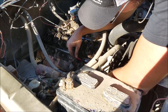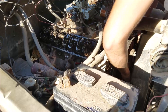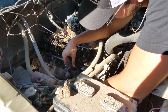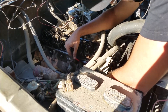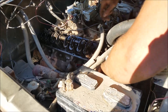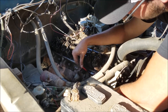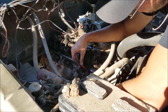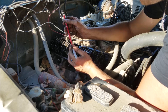Our measurements show we're still going down. Turn it over a little bit more — make sure to keep your permanent marker aligned. Continuing to turn it over a little bit at a time to see if we've reached our dwell point. It didn't move on that last turn. Our mark is okay — it started to get shorter now, so we've definitely reached the bottom. One more verification: the piston is indeed coming back up. You can see where we started and where we ended — this shows the importance of doing it a little bit at a time.